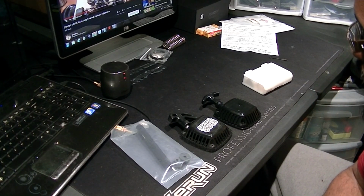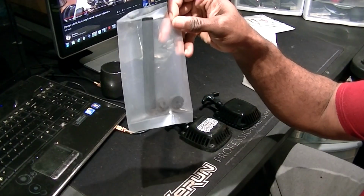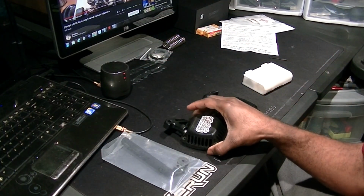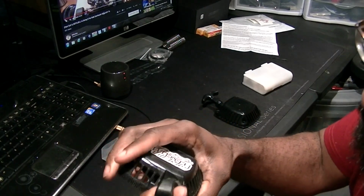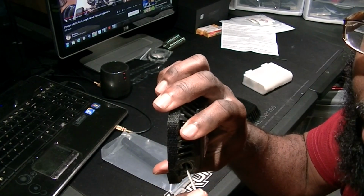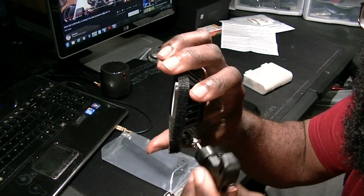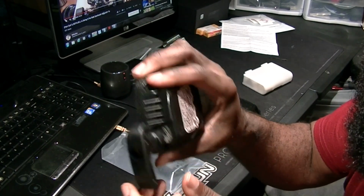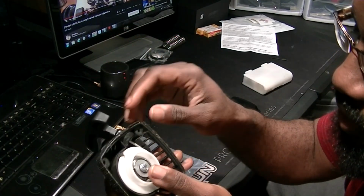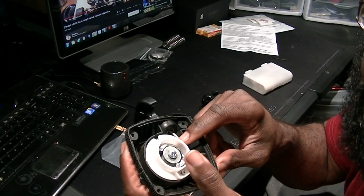Basically, we want to be installing a new pull start and also a pull start cable extension piece. First things first, this one right here is worn. My middle piece then broke off. The black one, I don't want it to fray. This is a Killer RC steel cable. I got it on a Turtle Racing handle on my OBR pull start. But the problem is that piece is worn, so it's digging into the plastic, so I'm replacing it before it becomes an issue.